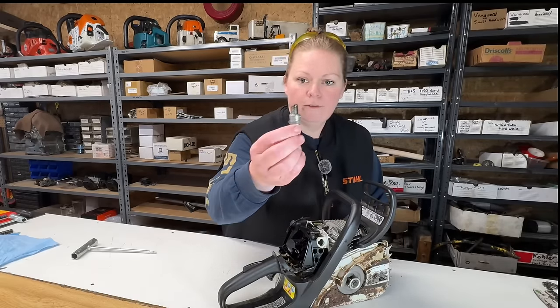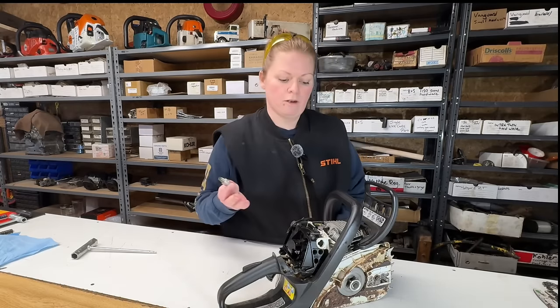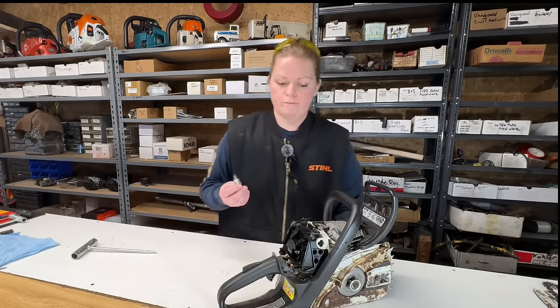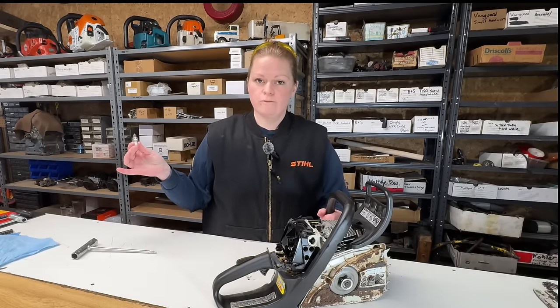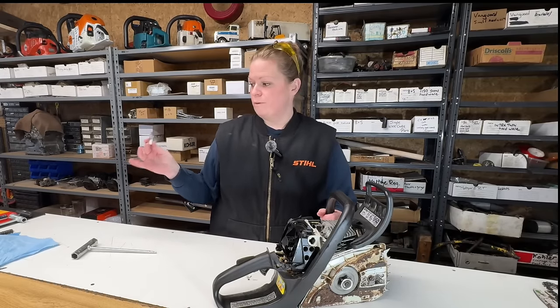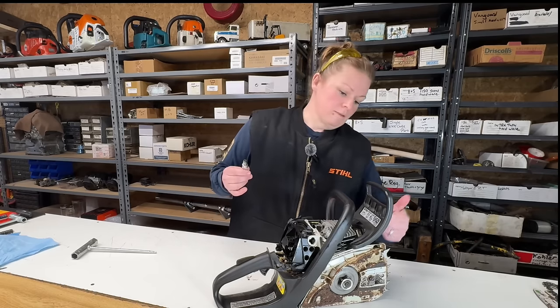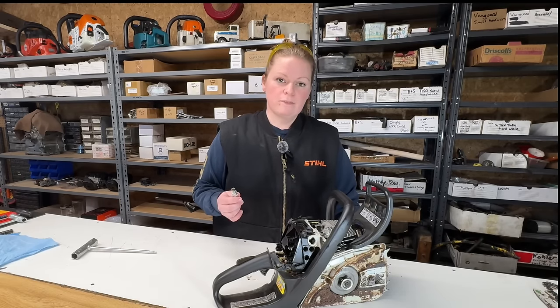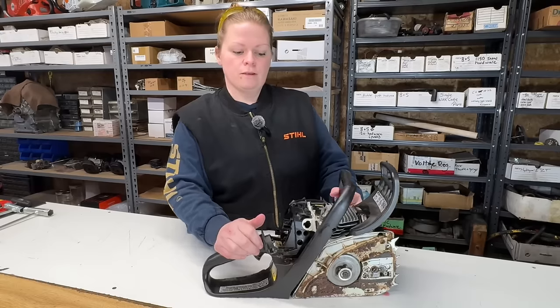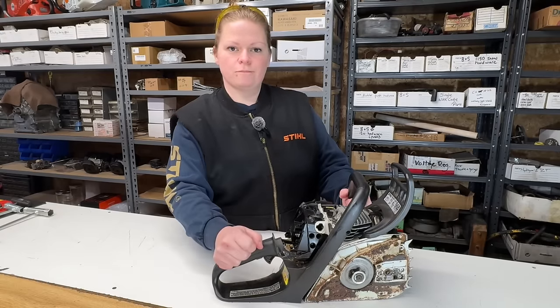Okay, so that spark plug is new. Somebody has obviously been attempting a repair here. They didn't mention it when they dropped it off, but a new air filter or a very well-cleaned air filter, I think it's new, a new spark plug. The spark arrestor is just missing, so now I get to piece this puzzle together. Let's get the camera out and take a look down the spark plug hole.